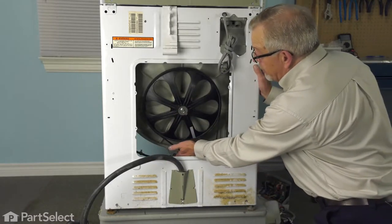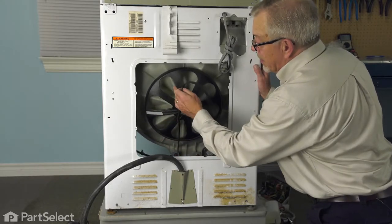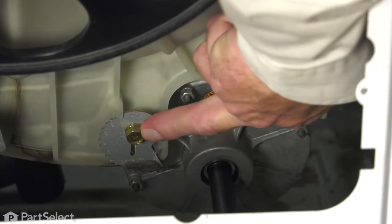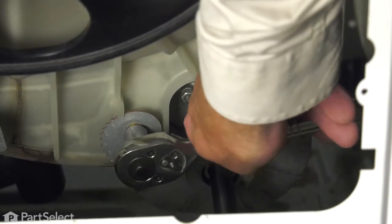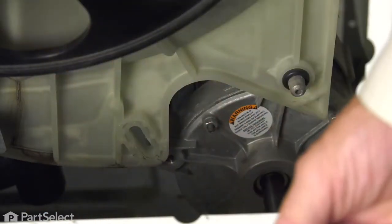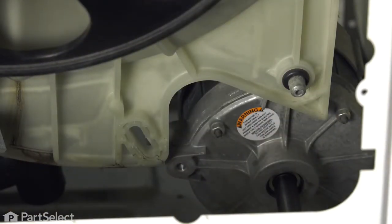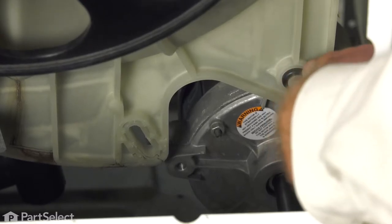Next, we'll roll the belt off of the large pulley and the motor. Just pull on while we're rotating the large pulley and then we'll set that belt aside. Now, with the belt out of the way, let's remove this bolt that secures the motor to the outer tub. We'll save that bolt and the adjusting washer. Now our motor should hang free. We'll just want to push it forward. We'll go to the front of the washer and pull it forward while we're supporting it. That will disengage these hooks from these rubber grommets.